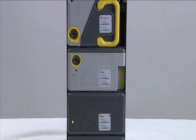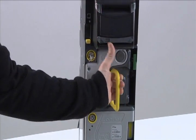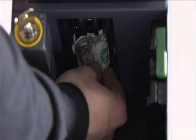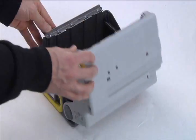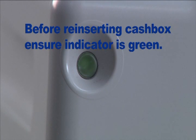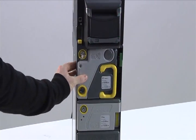If there is a jam in the bottom transport — the area of the BNR between the main module and the cash box — remove the cash box using the steps previously explained. Check for a jammed bill at the pusher plate right underneath the main module in the cash box slot. Remove the jammed note, open the cash box, remove all stored notes, and close the cash box. Before reinserting the cash box inside the BNR, ensure the indicator is green. If it is clear, open the cash box to re-arm it before reinstalling. If you do not have access to the key to re-arm the cash box, replace it with a spare cash box.